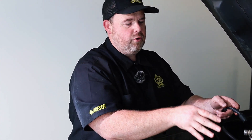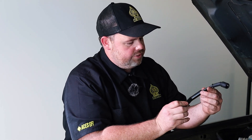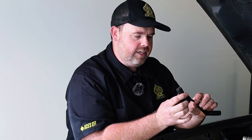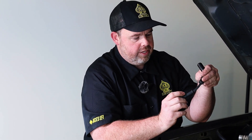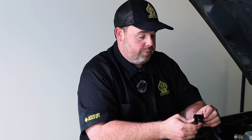To go with these coils, I used an ACES Fuel Injection 135-degree ceramic boot end and made my own custom boot on the other end at the appropriate length. This engine has swap headers that had to be modified because nothing really fits a Blazer. Thankfully there are TIG welding skills involved here. These 135-degree boots and the LS boot ends work really well with our wires — I've not had any issues with them. They clear the headers just fine and deal with all the residual heat from having headers.